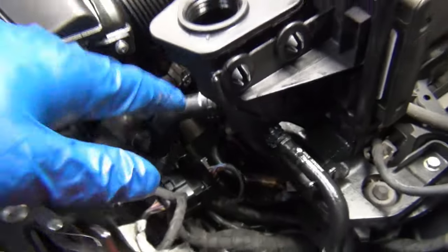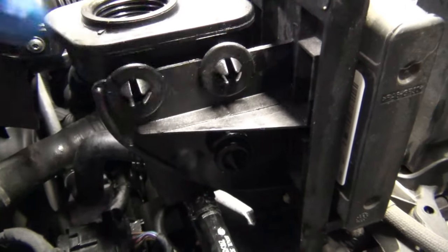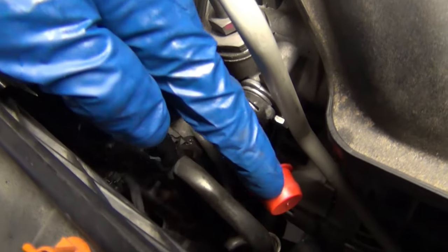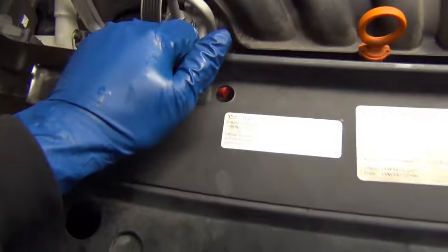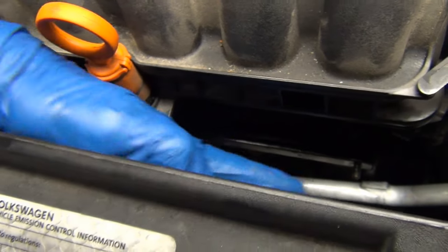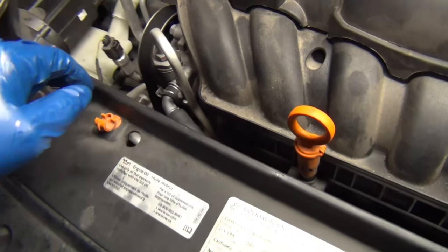So you've got this mounted and these are all connected. You want to do this first — you've got a smaller grommet, when you put it in it goes in and then drops down. You might have to get the little lips of this thing around obstacles. Do this first because remember how we save our cap plugs that come with parts — we capped this and there's still some fluid behind that. I flushed it backwards to get all the crud out, cleaned the reservoir, but now we've got fluid that wants to go crazy. Set up the drain pan, got the diaper off the bottom of the car. We're going to pull this off and stick this on, and after that then we stick our brackets on. If you stick your brackets on first, like it's tempting to do, then you're going to be stressing the line and having this kind of problem happen. Do this one first so we can't spill — once it's in there it's all connected, and that gives us some flex in and out side to side.